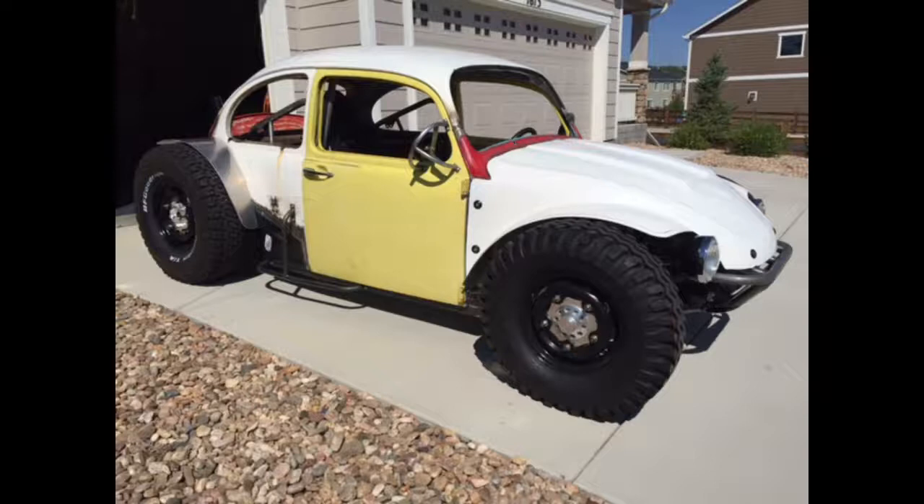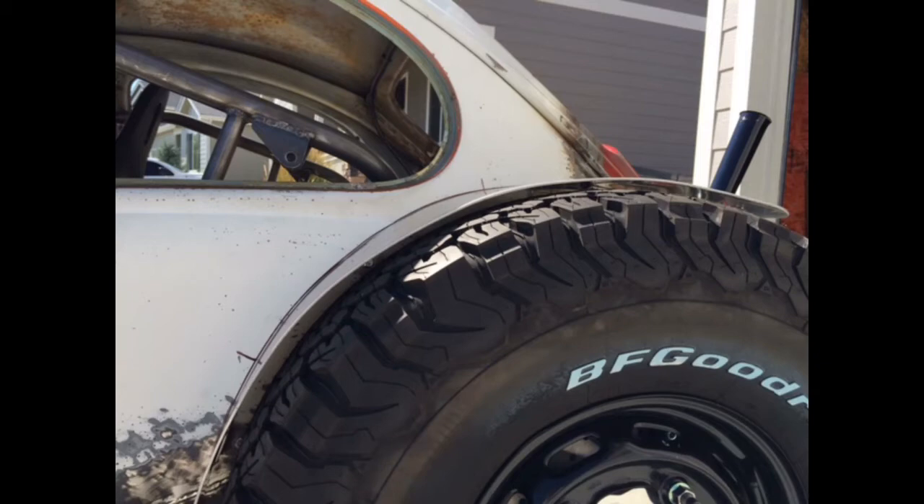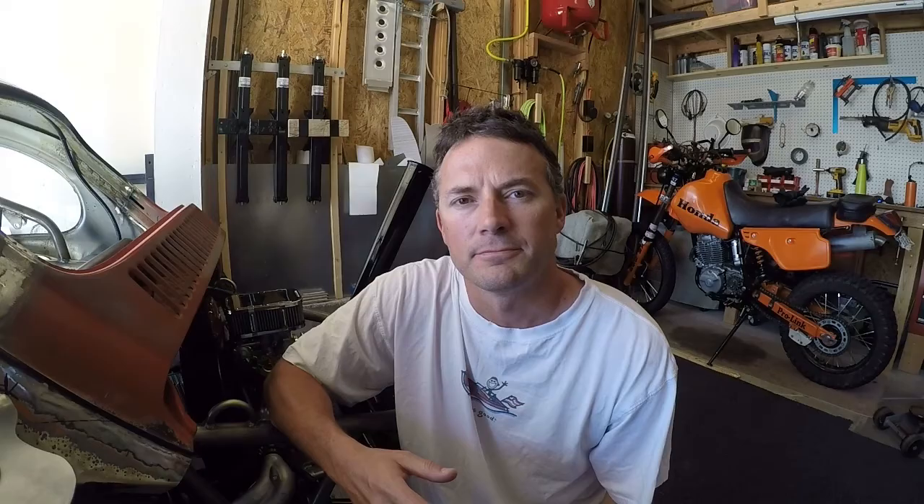What I decided to do in the meantime was work on the rear A-arm suspension, which I'm finishing up right now. What I've done lately is take all of the shocks out of the bug so it's completely sitting down on its bump stops on all four corners, so I can work on the rear fenders and build them so they're just off the tires at full compression.